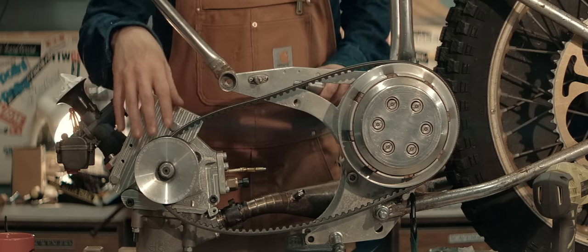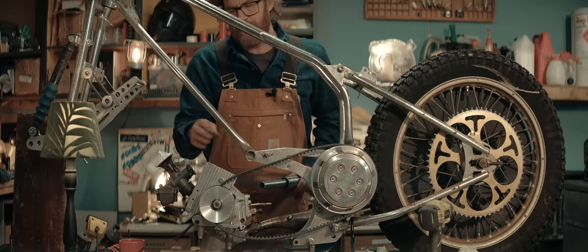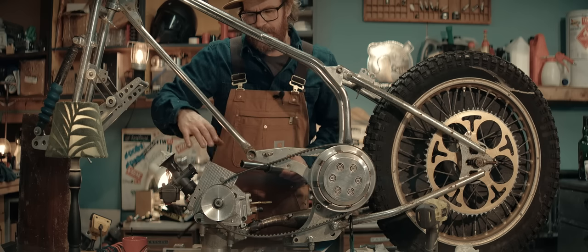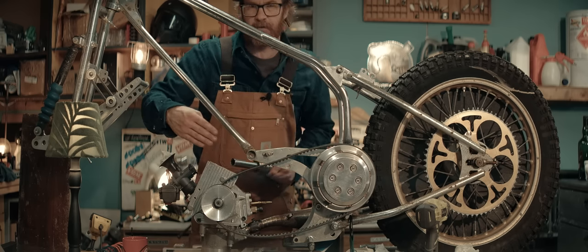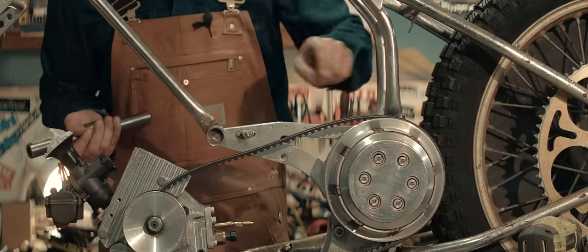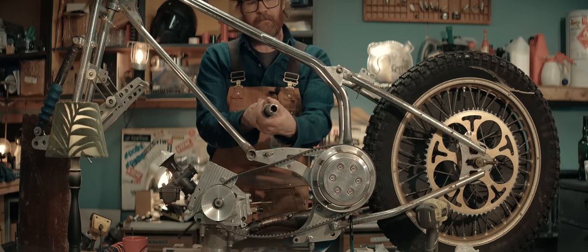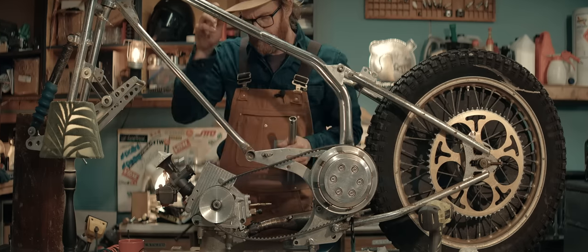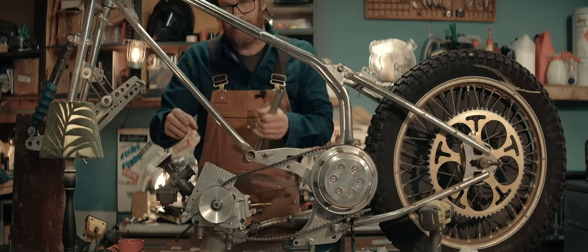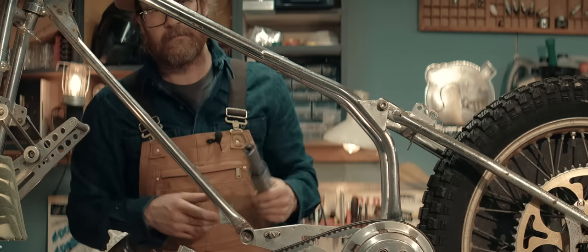With just one variable pulley and a fixed rear pulley, you either have to live with the belt being out of alignment everywhere except one point in the transmission, or you'll have to make the engine able to slide in and out whilst swinging, or sliding up and down, back and forth. You can also make this slide in and out. Using one of these as the swing mount, it can both swing and slide in and out. I was trying to figure out some other arrangement for the sliding engine to have it self-aligned. This takes care of both things in one.